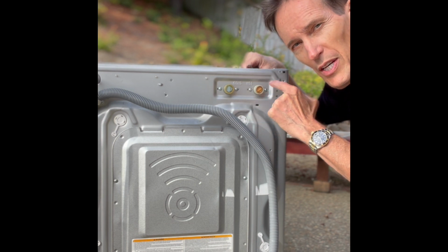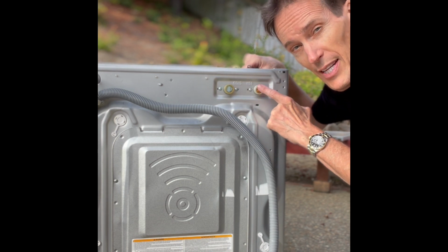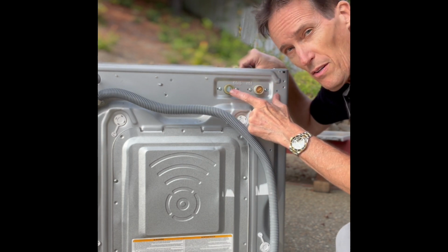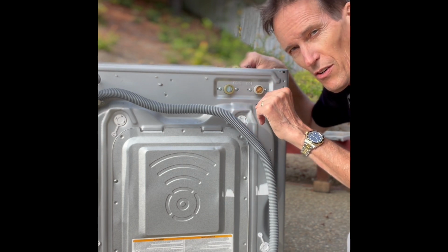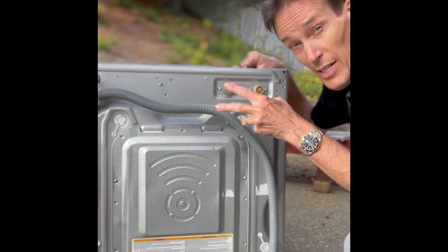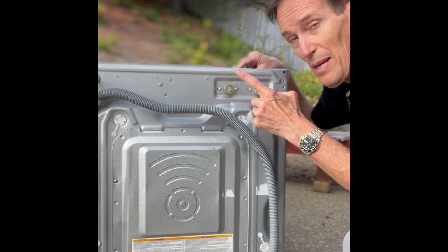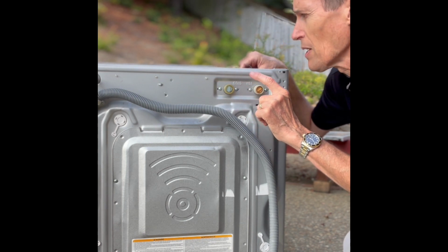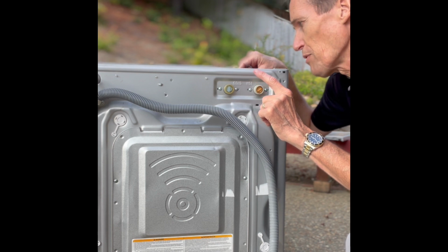It does a rinse really good. Remember, we just did the hot side today. We cleaned the filters, did the hot side. But the cold side is the same deal. The only thing that's tricky about it is that there are 3 hoses and 3 power connectors. So you want to just label them so you remember, or take a picture with your phone. And then this procedure is the same.